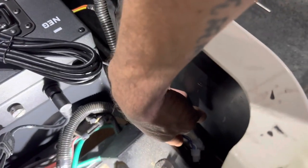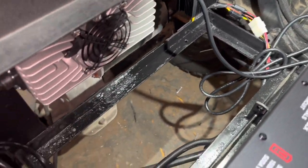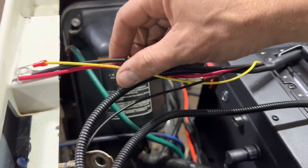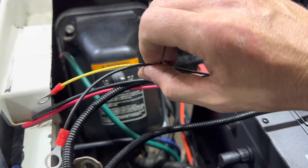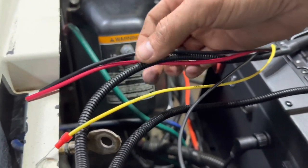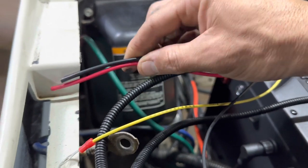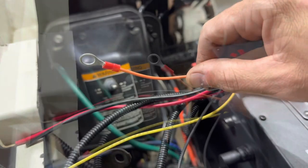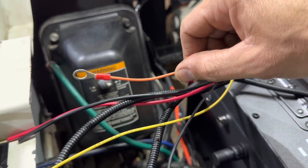Plug your 12 volt reducer wiring harness up and run it along the battery frame, securing it there, and get it over to the terminal side of the battery. The 12 volt reducer wiring harness — you'll see that the black and yellow have eyelets on them. These are the 48 volt input and will go to the main positive and negative terminal of the battery. The slightly bigger gauged black and red is your 12 volt supply for your lights or fuse block. The last wire is the long orange with the eyelet — run that to the key switch on the cold side so your 12 volt supply activates when you turn the cart on.